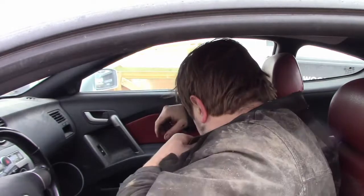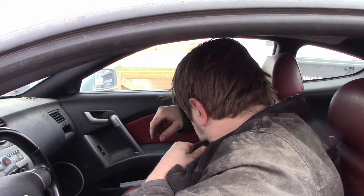Alright, so I just took it out around the block, and so far, so good. Temperature gauge is up, so we're fully into the computer controlling everything. We're idling about a 15 AFR, which isn't too bad — they probably run it pretty lean for idle, so there's not much to worry about. But during the run around there, it stayed pretty consistent in the 14 area, plus or minus whatever. So I think it's kind of taken to the ethanol here.